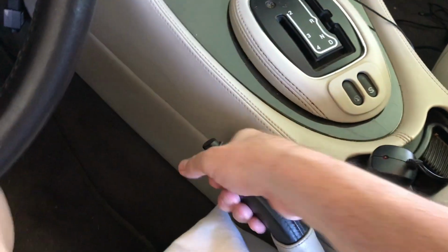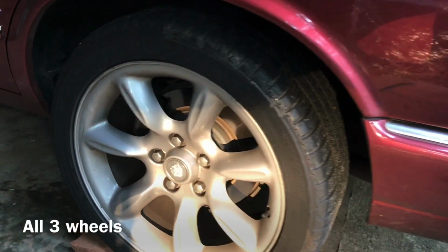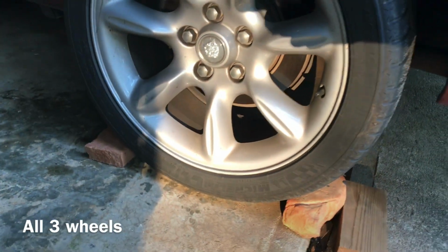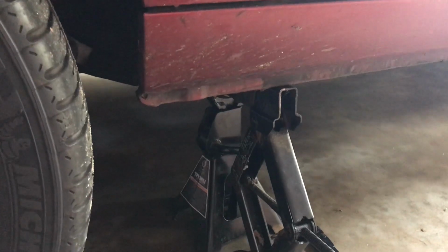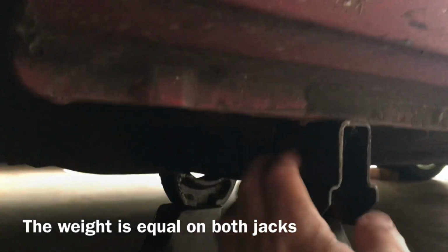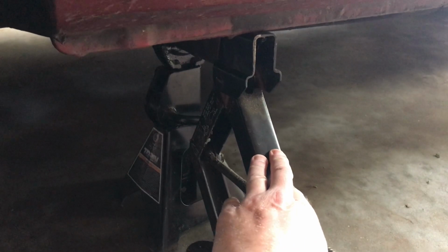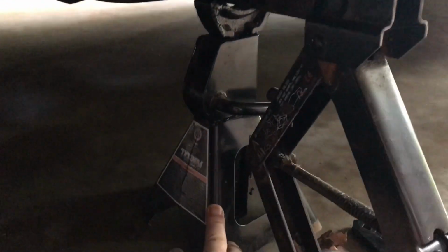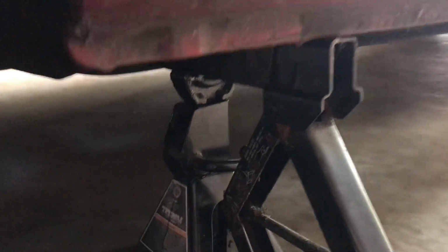First thing, it's got your tires. So it's the next morning, I had to stop because it got to 95 degrees outside. What I've done is get the 3-ton jack stand, and also got this. Don't ever do it with just this, it's not safe. Get the jack stand. This is a 3-ton, it'll hold the whole car up. So now the car is safe and it's not going to fall on you.